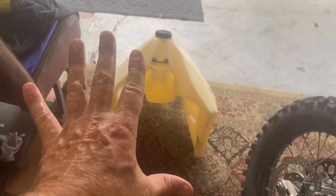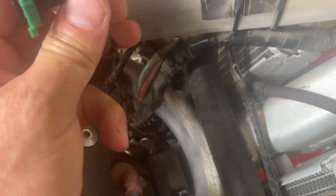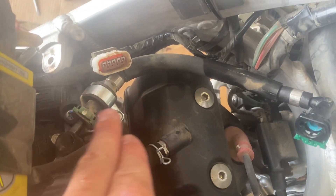You want to lift the tank up just a little bit but not all the way out because you've got to take off the electrical connector and then the fuel line. With the aftermarket tank being big and bulky with more gallons, it was a bit difficult. You just pull the green piece out and then the connector slides right out. Here's the electrical connector — we had to take it off at the tank side.